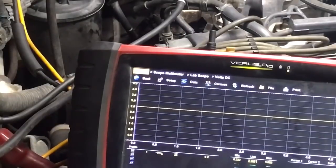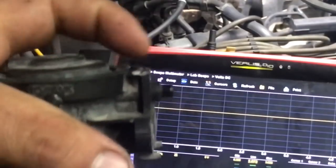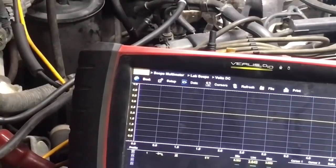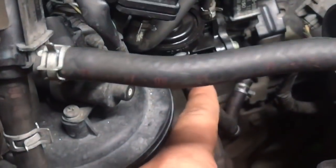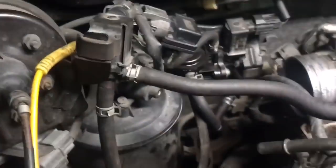The fix on the P1456 was a two-way valve — there's a small little crack. I got the valve right here and this goes to the fuel tank pressure sensor. There's a small, slight little crack, and the way I found this out was by hooking up my smoke machine. Now to test out the actual fuel tank side, or the whole system, you can just release the pliers. On the two-way valve there are two hoses — one goes to the canister and one goes to the fuel tank. I put pliers on the fuel tank hose to make sure we just tested out the canister side. Now we have it open and we're going to test out the actual whole system.